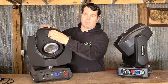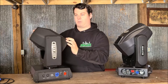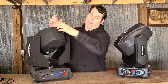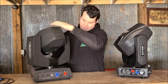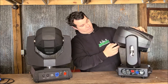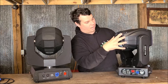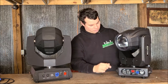We have two fans here — a fan angled here and a fan angled here — and there is one right in the back near the bulb. To get to the bulb, you've got to pull this off, pull the plate out, and then the light bulb comes out. On the 10R it looks like there's a fan here and a fan here. To take the case off, you'd have to remove the four screws and the lid probably just pops off.